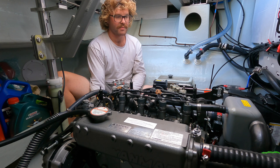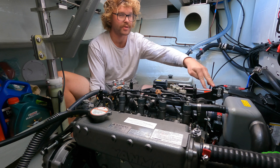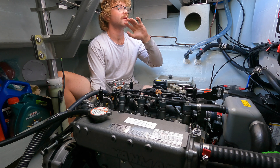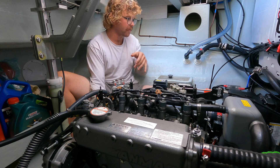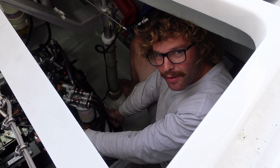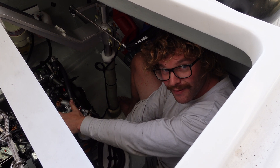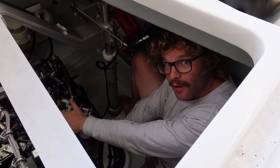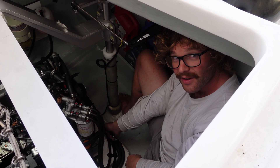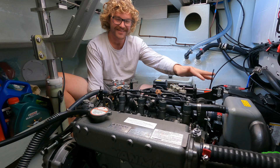Something I should have said at the very beginning: isolate your motor. You've got an isolation switch, and you should also have isolation switches in the boat somewhere. Diesel engines run off compression, so if you're turning the motor and it's not isolated and you're compressing what's in the cylinder, you could start your motor — and if your hand is on the ratchet when it fires up, you're going to have a bad time. So isolate it, then rotate it.